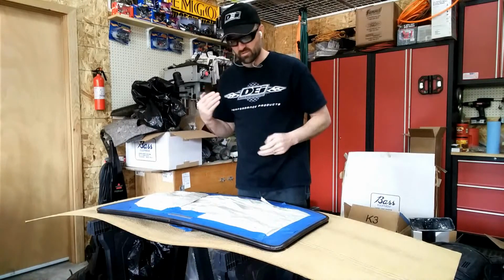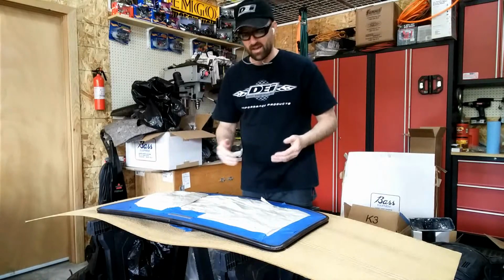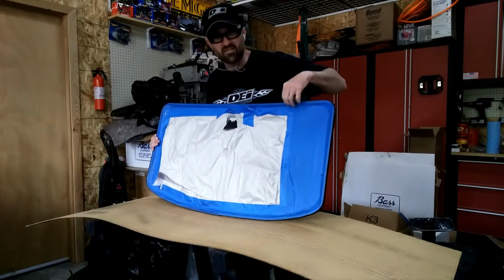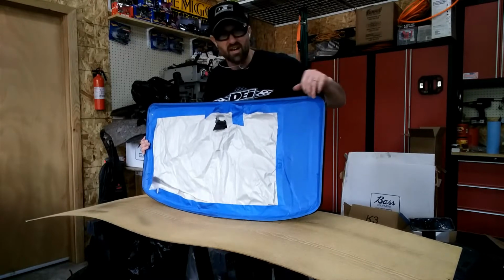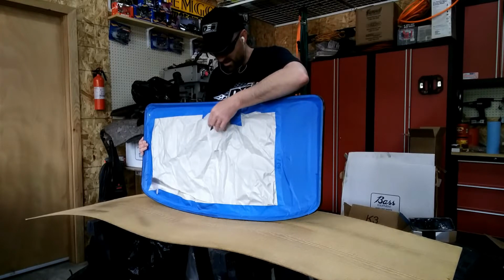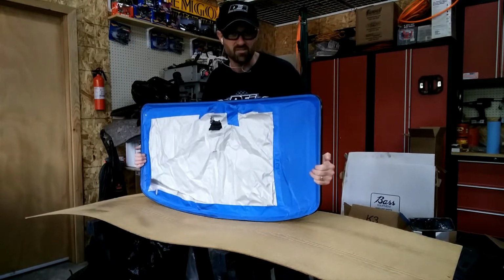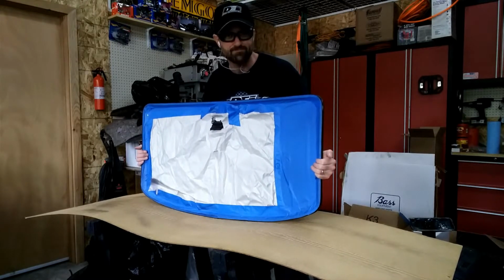So I need to use some etching primer on it, get that etched and primed, on both sides. So if I show you the back, it's the same way. Now I've just come again the edge here. Everything under here really just needs to be cleaned. So I will do that soon. Once I get all this done, I'll just take some glass cleaner and wipe it down. It did not need to be repainted, and this popped through the paper here, but that's okay. Just don't paint it. It'll be fine. So now I need to do some self-etching primer, see how that comes out, and then I'll move on to some black.